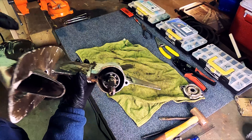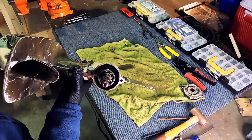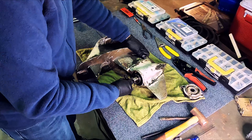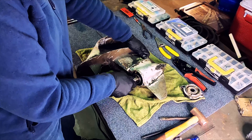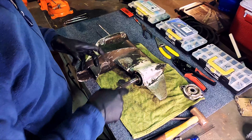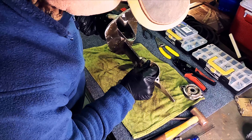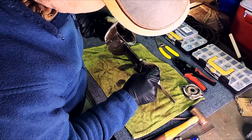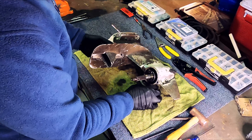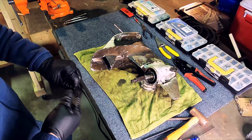This is what the inside of your prop gear housing looks like - this is your main bearing that your prop shaft rides on, and behind there are your gears. I'm not going to tear this unit open because I'm already very comfortable with the feeling of those gears - I'm not getting a lot of slop in them, they feel very solid. The main reason for doing this is to get a good look inside and observe the teeth of the gears. Next I'm going to get a container to drain all that residual fluid into and then work on flushing it out.